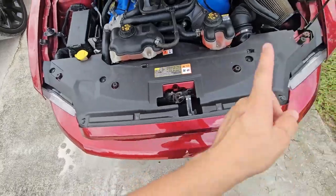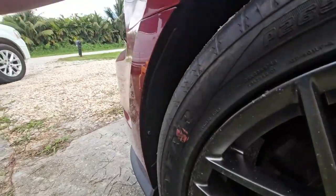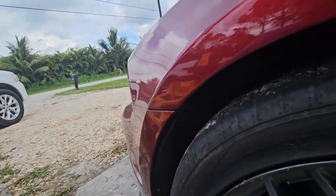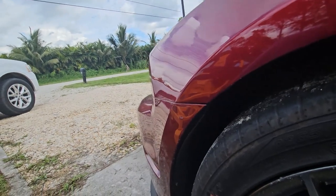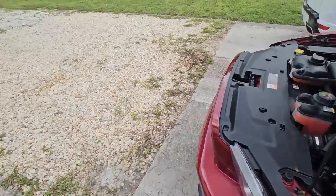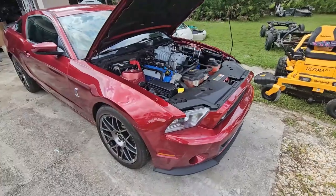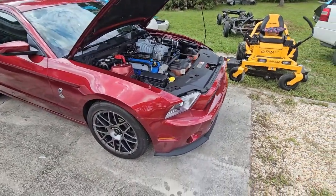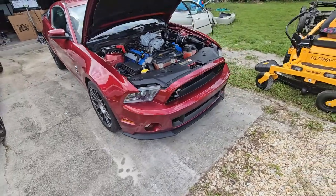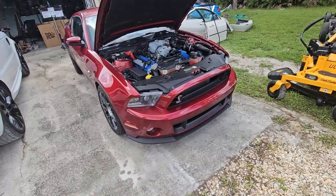There are two bolts — I forget if they're 8s or 10s — to pop the cover off. You're going to want to cut the wheel each direction, and there are some screws up on the inside lip of the bumper cover. Depending on what's easier for you, you may want to jack it up and take the front wheels off — that's usually easier, so that's probably the route I'll take. I'll pop the front cover off first and then document the rest of the process. It will be different if you have a GT or V6 car.